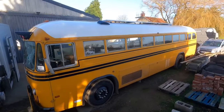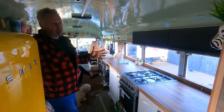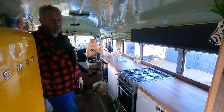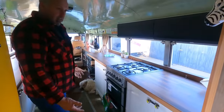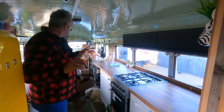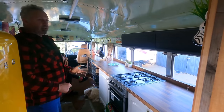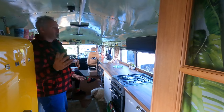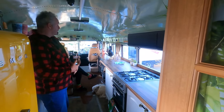On the top we have three solar panels at 320W each, giving 960W — nearly a kilowatt. That drops into five 110Ah leisure batteries all linked together, giving 500-plus amp hours. Then I've got a 4000W pure sine inverter that powers all the 240V stuff. We also have a 12V system running throughout — the LED floor lighting, strip lighting, Maxxfan, and two diesel heaters, one at the back and one at the front, all on 12V. The inverter powers the Smeg fridge as the main draw. One TV is 12V, but the PS4 is 240V, so we don't have a massive amount of 240V demand.